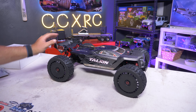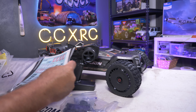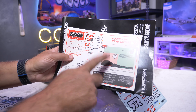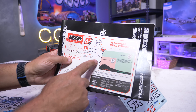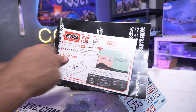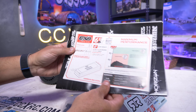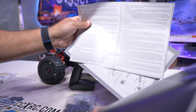Here's a quick look inside everything that you get — stickers included. Standard gearing is a 15-tooth pinion with a 52-tooth spur gear. They also give you a 23-tooth pinion, which really ramps things up — going from 50-plus miles per hour to 70-plus miles per hour. That's running on a 6S LiPo, but you can also run it on 4S for different speeds.